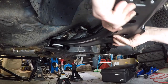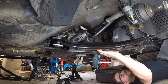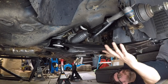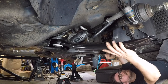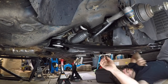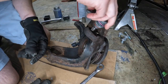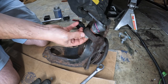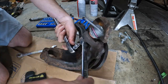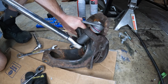Now we're going to install the new control arm on the passenger side — slide that into place. I used a little bit of lubricant to help it slide in, then replace the two bolts that held those in. They are stretch bolts — I purchased new ones for this project, so make sure you do that when you do your install. Once this is finished I'll need to go back and redo all the subframe and make sure that's installed properly. Finally we're going to install some new ball joints. They're super easy to install but note that they are sided — these connect directly to your control arm. Go ahead and tighten down that nut, holding it in place using either an allen or torx bit, then torque it down.